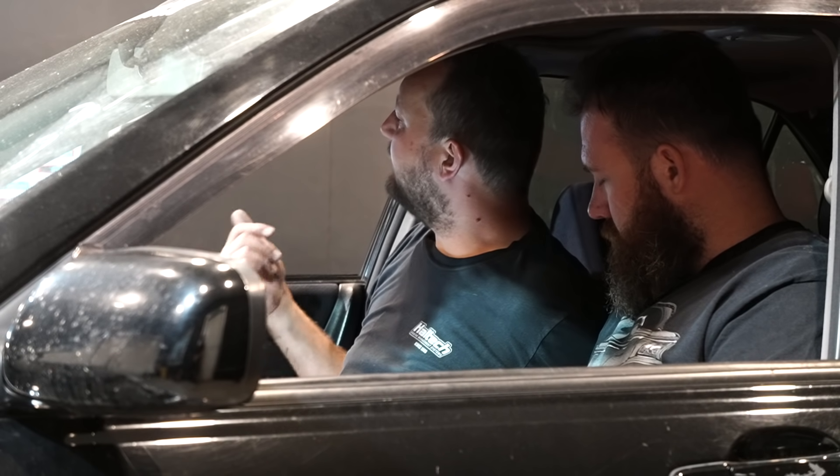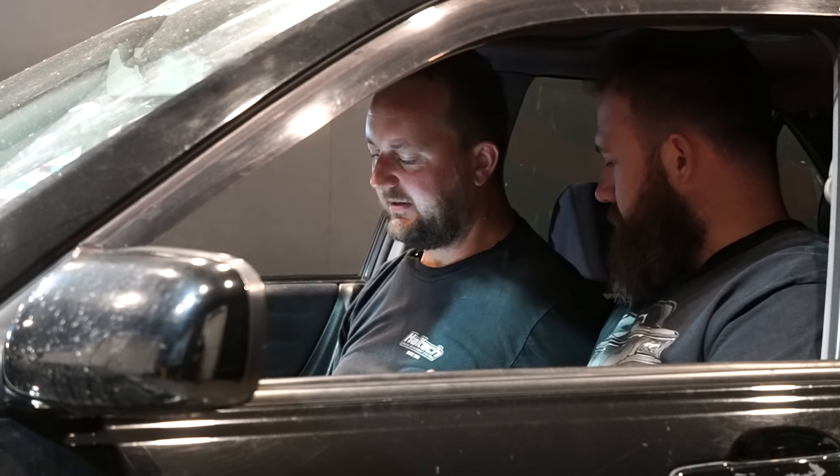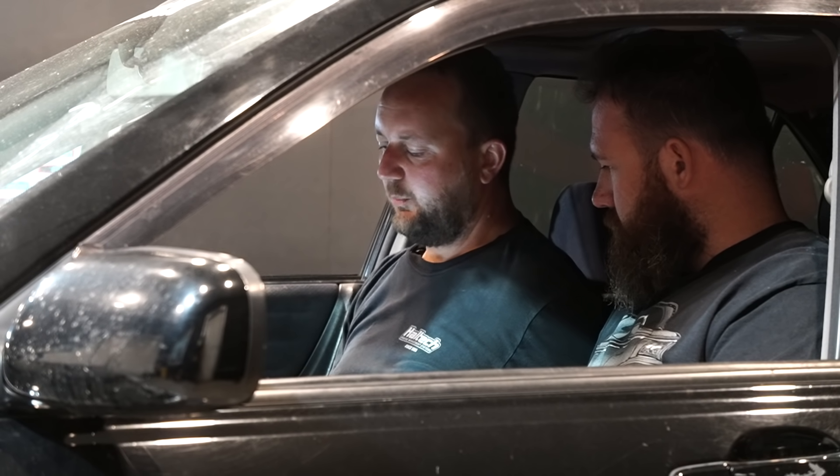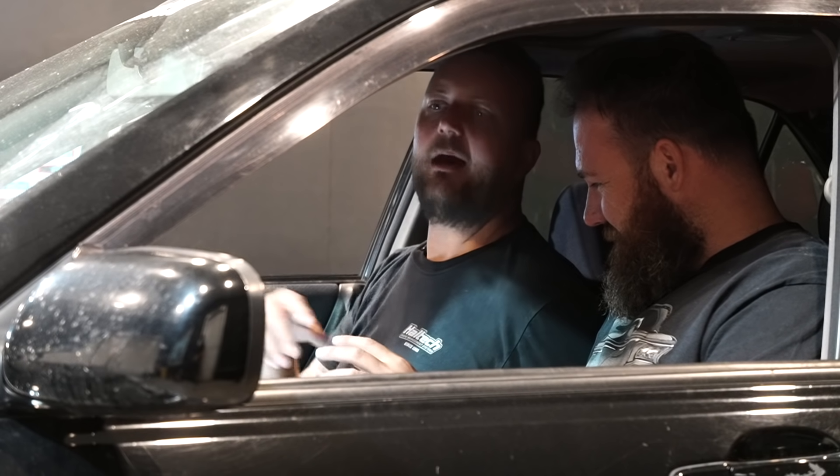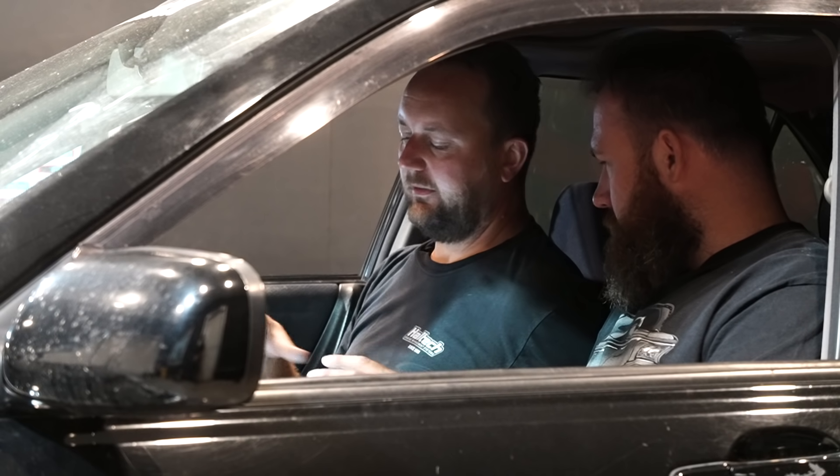It's now adding 13 — a mixture of the two together, so in the ballpark at least. Now coming back to idle it'll be rich, probably because the dead times are now too high. At idle, dead times are a huge amount of the actual total injector opening time, whereas at 50 kilowatts it's a much smaller percentage. That's why I'm trying to balance 50 kilowatts to get the rough flow rate, and idle to get the rough dead time, then work from there. We could pull the injectors and put them through a flow bench, but with O2 correction we've just done that work in three minutes. Or you could buy injectors that come with all that data and type it all in, then still do overall trims to get it in the ballpark.